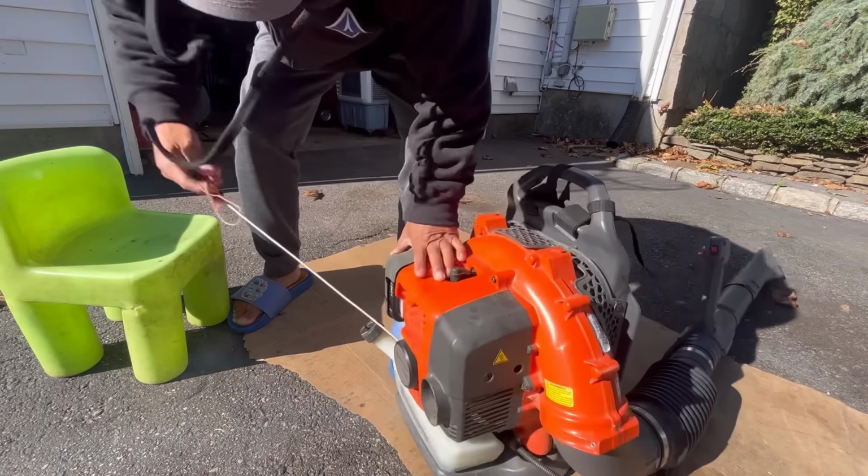Very damaged over here too. This line here is very deep. Clearly feel it. I want to know whether or not I could get away with not getting the bore, because while I do feel it with my fingers, it is really low down there. And on the top there is scoring too, and I do feel it. So I guess that would make a difference. If you could feel it, then you'd probably have to replace it.